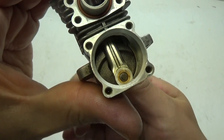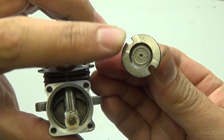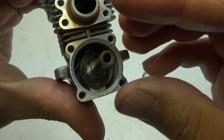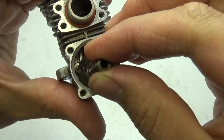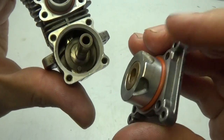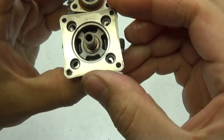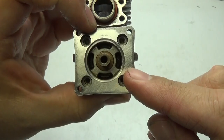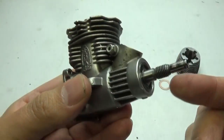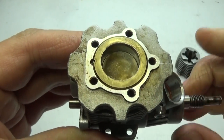If it's not spinning easily, make sure the sleeve isn't pushed up — the base of the piston can hit the inside of the engine block. Pull back on the crankshaft while you turn it to confirm it turns smoothly. Next, slide the piston all the way down and grab the piece that has two notches, one on each side. Use that notch to hook it over the peg that connects to the piston — this is the shaft that hooks up to your starter. Get the back plate, which has two little notches at the top, slide the shaft into the bushing, and push it all the way down. Attach the four screws in a star pattern: upper right, bottom left, bottom right, upper left. Once done, turn the crankshaft — if there's enough oil, it will make a little thumping noise, which is perfectly fine.